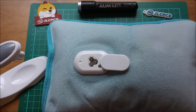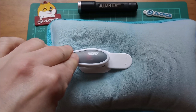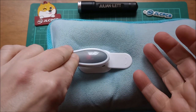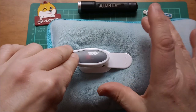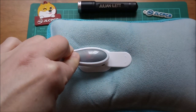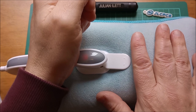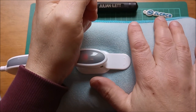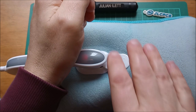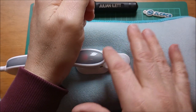You can get round that and I'll show you how. The solution is that you just hold this down, and you have to put quite a bit of force on it because this thing puffs up and really fights against you — it's getting quite high pressure inside. You have to impart quite a bit of force on this connector to actually get the contents of this bottle the least bit warm. It doesn't feel particularly good doing this because there is a concern that the bottle will explode — it hasn't yet. So this does work, but you are overriding one of the safety features, which is the micro switch in this connector.